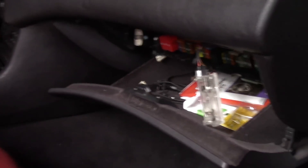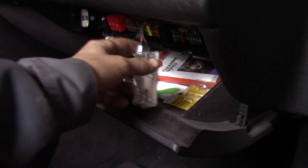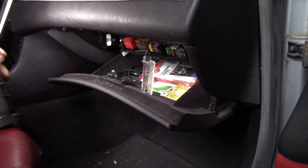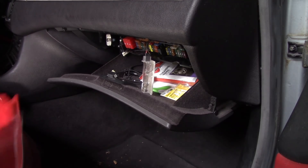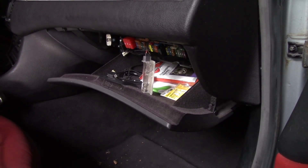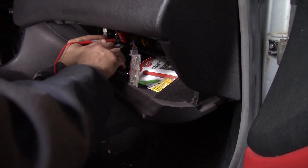What I did was get to my fuse block. This vehicle has three fuse boxes — for those familiar with BMW, one of them is in here. I disconnected my light here so there's no drain at that point. I've got my favorite tool, the AmpProbe — not really one of my favorites — but this is where this thing shines. We're going to show how this works by crossing my fuses.